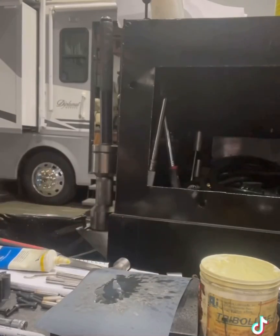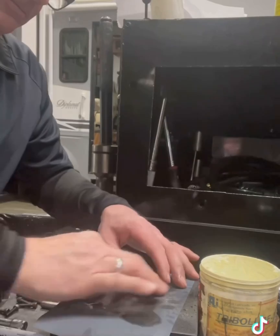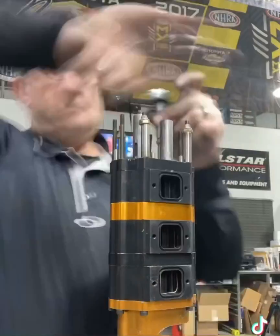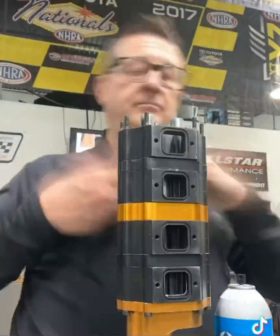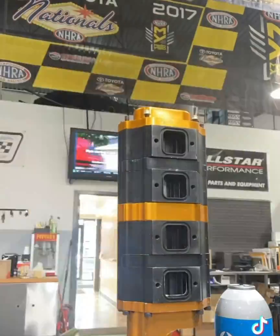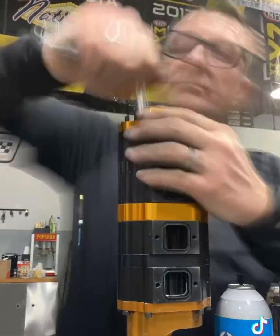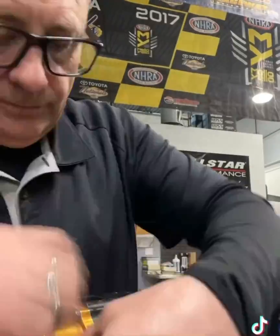When you're talking tenths of thousands, you have to hand sand these end plates. After I put each section together, I'll take it off of the holder and turn each section every time to make sure there's not an issue. I finished up the fourth stage of this pump, gave her a quick spin over, and it feels really good. So I put the fuel shutoff cable bracket on it and the inlets. I'm taking her over at 8:30 tomorrow morning, and we're going to flow this thing. Stay tuned.